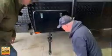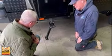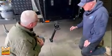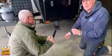You can still use everything safely throughout the Caravan. You can angle the stand, and sometimes it actually helps to angle it a little bit. When you wind the feet out, those will pivot and take it to the ground. Now on here you've got this 19mm hex drive point. Under your bed you've got a crank handle to wind that up and down with.